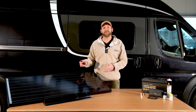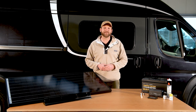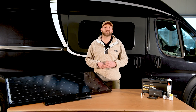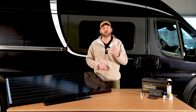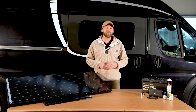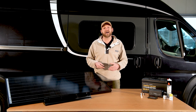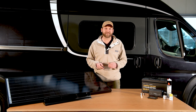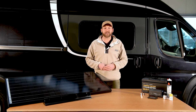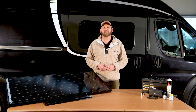Along with the solar panel we have here, we will also install this Dometic SC330 solar charge controller. This is the latest and most innovative solar regulator for solar modules, with separate inputs for two solar panels and two battery outputs. The 330 in this product name refers to the maximum number of input watts — in our case the Blackline 110 panels will generate 220 watts. The state-of-the-art MPPT technology — maximum power point tracking — allows you to enjoy up to 30 percent more energy from your solar panels.